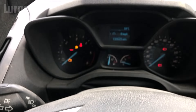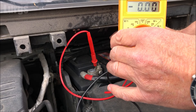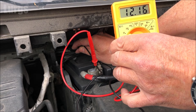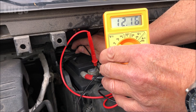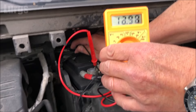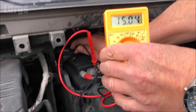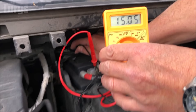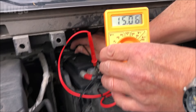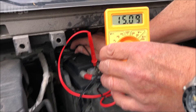Get someone to get into the van and put the ignition on while you've still got those probes on — you'll see that the voltage has already dropped down. Then get them to start it up. The voltage should drop right down as it attempts to start, and then the voltage should go up to prove that it's charging the battery correctly. Now the engine's running the probes are reading 15 volts, so that is charging correctly — perfect.